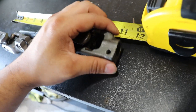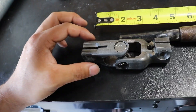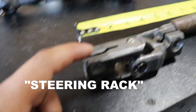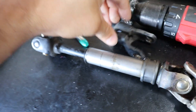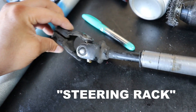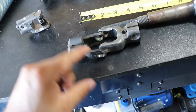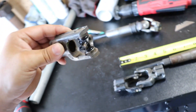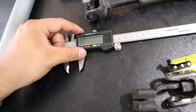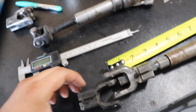What's nice about this steering slip yoke is this part is going to slide right onto the bottom of the motor. This part should be sliding onto the 2G column, but the one that came with the Prius does not fit the 2G DSM. We actually have to take off the slip yoke that connects to the 2G column and transfer it over to this guy. Unfortunately, we have to press out these little tiny U-joints, and if you haven't pressed out tiny baby U-joints, it is kind of a pain. I'll quickly describe how to do it.